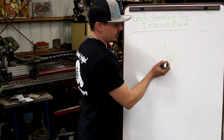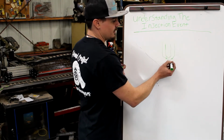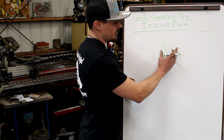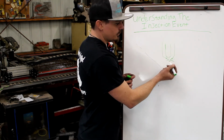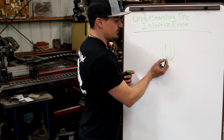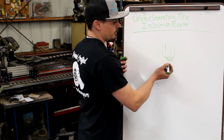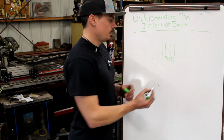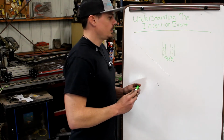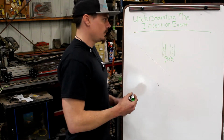So you have a lift pintle. This lift pintle seats in different places based on the injector design, but for the case of drawing this, the pintle seats here, and there are holes here. As the system gets larger, or say the hole size gets bigger, you can look at a couple different things. Per amount of lift of the pintle off the seat, if it's larger, this space gets bigger faster per millimeter of lift up. That's how you run into where the hole size can get really large, and you'll not have enough space to flow fuel around the pintle into the hole. You've limited the injector from getting bigger, and the pressure just drops coming out of the nozzle.